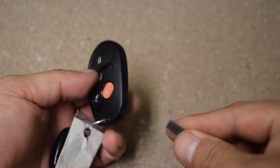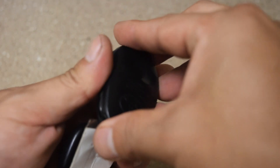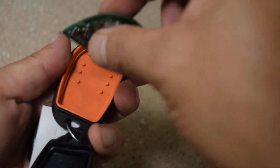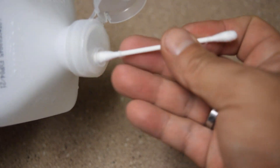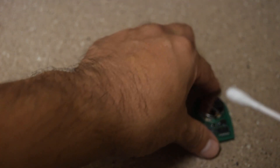So what you could do is get any flat object, kind of just pry that open, and it shows you the inside. What often happens is these terminals get crudded up somewhere by random dirt that gets into it. What you do is take 90% isopropyl alcohol and just get a little bit of it onto the tip of a Q-tip.